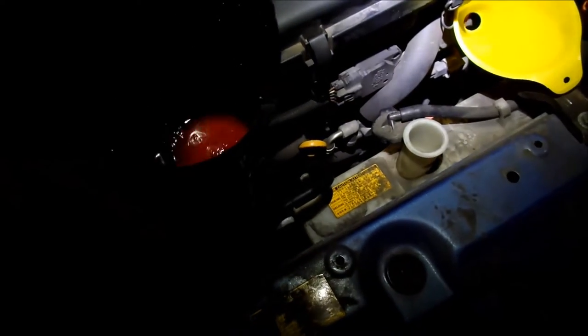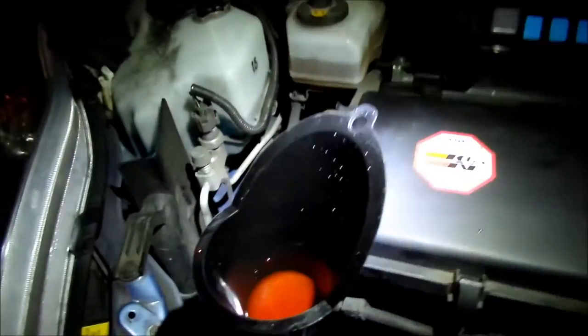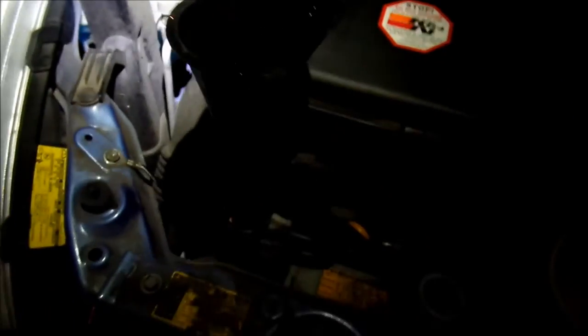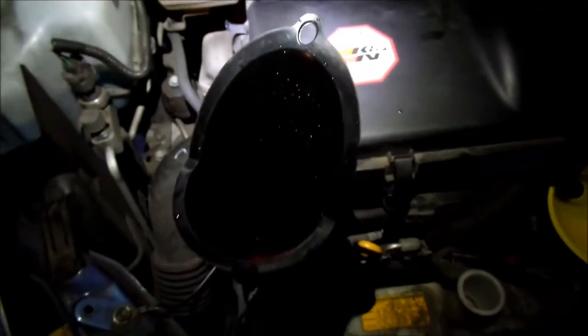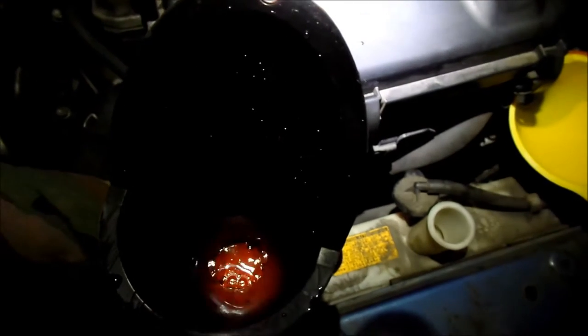I can actually feel the water going into the hose. That's the one that goes to the engine, though. So the other one would probably be better to squeeze out. Yeah, so what it looks like you want to do is squeeze this hose right here near the inverter, the big one. Squeeze it. And then squeeze the other one. Just alternate, yeah, see? If you alternate squeezing the hoses, works real good. See this air coming out.